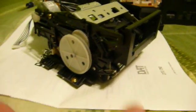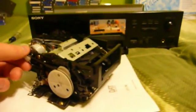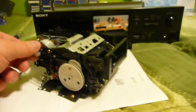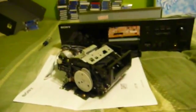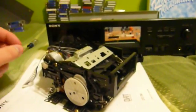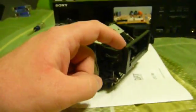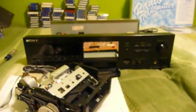There it is. I've just gently hooked this back where it came from, using the reference photo from Audio Karma — that Audio Karma member Sassy, S-A-S-I, was kind enough to provide from one of his decks. He also authored this excellent thread on repairing these things. At the risk of repeating myself, if you have a Sony DAT machine that's broken and it's having trouble loading or winding a tape, you can probably use his excellent post to fix it. So that's what I've done here. Now I have to go ahead and just put the mechanism back into place and go again.